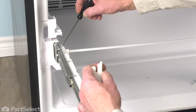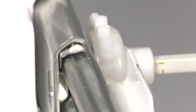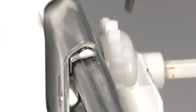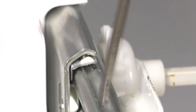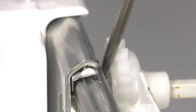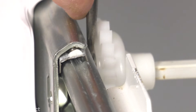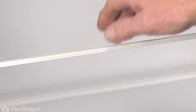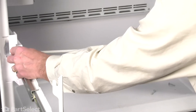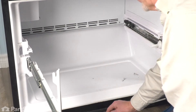Now with the lower track pulled completely forward, we're next going to release this drive wheel on the left side. Just take a flat blade screwdriver and go in between the nylon drive gear and the metal track. Just pry that gear towards the center, then lift up on it and pull it completely away from the right-hand side and set that aside.